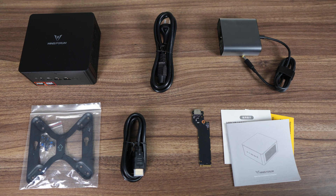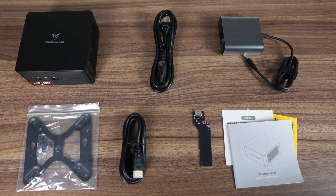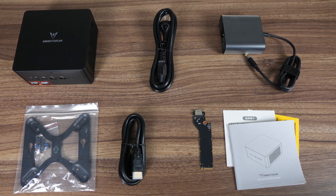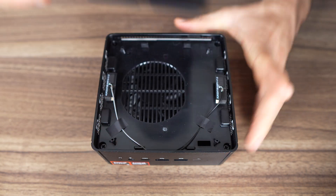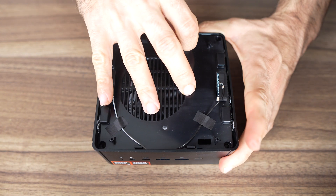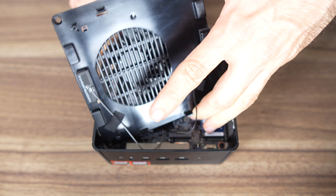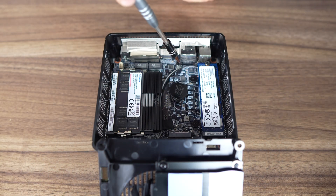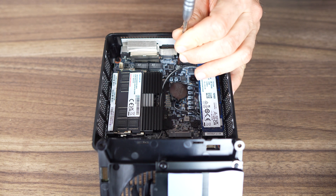In the box is a compact 120 watt power supply, monitor mount, HDMI, and the M.2 Oculink add-on you need to slot in manually if you plan to use it. To open it, lift the magnetic lid, then remove the four screws. Watch out for the fan cable while lifting it — you'll need to disconnect it, there's no other way. Watch out for the wireless cables too. Inside we've got dual M.2 Gen 4 drive slots, and I'm just going to add the Oculink add-on card right now.